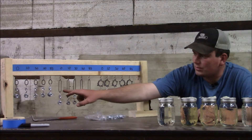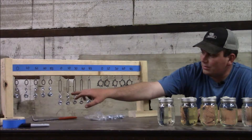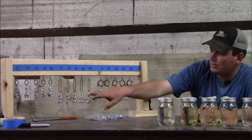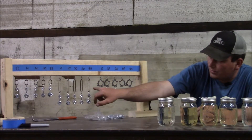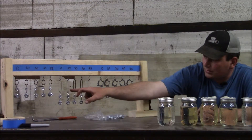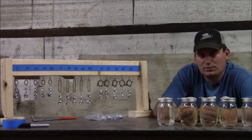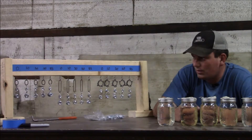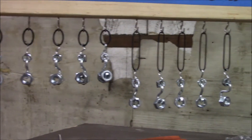The 0% ethanol on this end is stretched the least. Then the middle two blends show more stretch. As you add ethanol at 50% and especially at 85%, you actually lose that stretchiness — the width is a little bit wider, similar to the non-ethanol samples. And of course the E10 and E30 are a little bit thinner. With the thicker but smaller O-ring, the E85 is really similar to the non-ethanol.